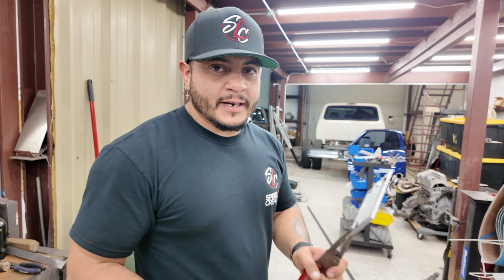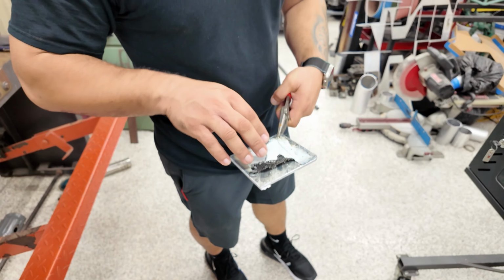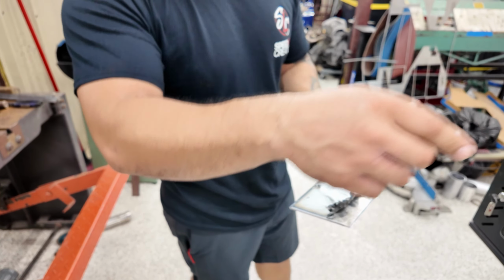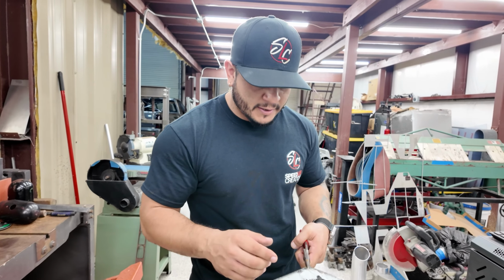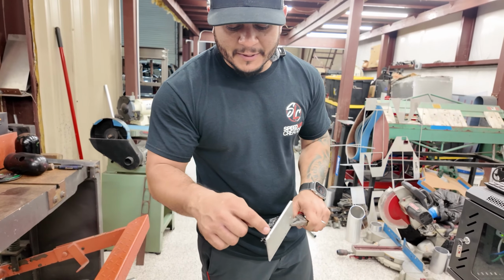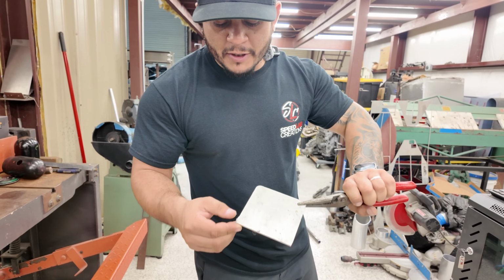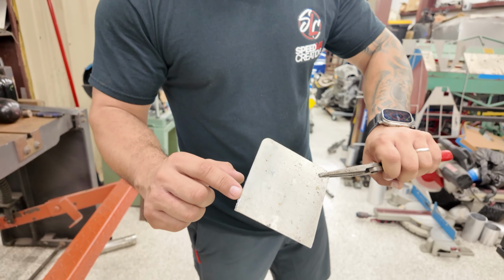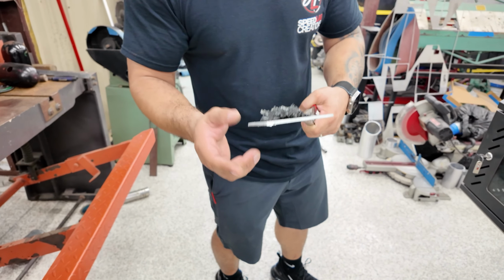Alright, so basically now that we can cut it out, you can kind of see it has this plastic wrap that we normally order with, just to keep the surface clean. Obviously one side will always be scratched from putting it on the table and everything else, but we try to keep it nice and clean so that the final product looks really, really good. In this case, before we rip it off, we'll clean the edges off from the plasma. We'll have a little bit of slag here and there. I got the machine to cut as good as possible. I could probably make a little bit more adjustments where I don't have much of this, which is basically called slag. But I'm going to clean the edges up, round it off a little bit better, and then take the tape off, wipe it down, and we should be ready to leave.